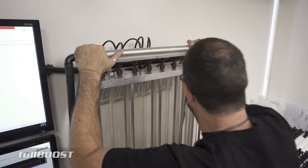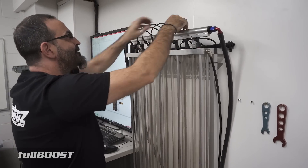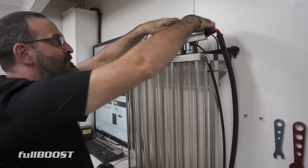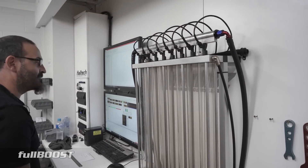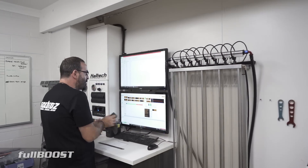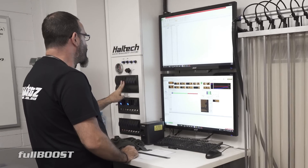So you were saying earlier you do a 25% and a 75% duty cycle test? That's correct. But what we do first when we run a brand new injector is we flow them for exactly 60 seconds just to excite them — just to check they're working and make sure that they're running well. So now we're going to turn our pumps on and I'm going to fire all of them at once.